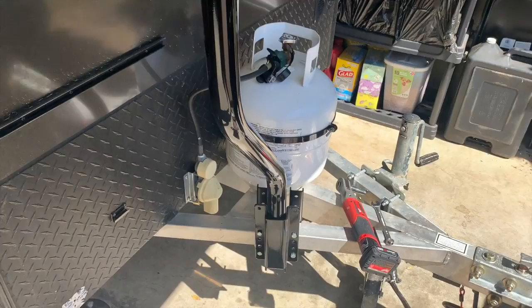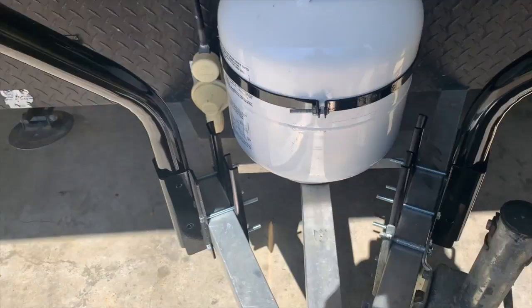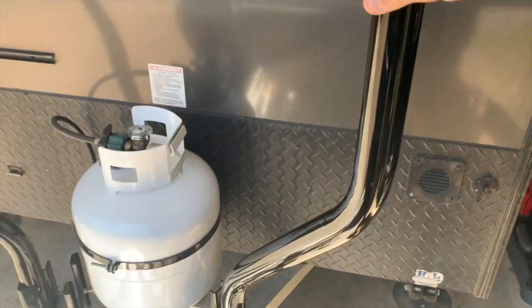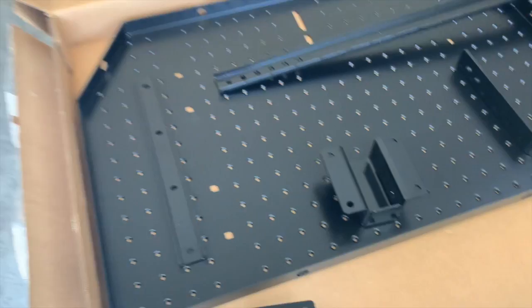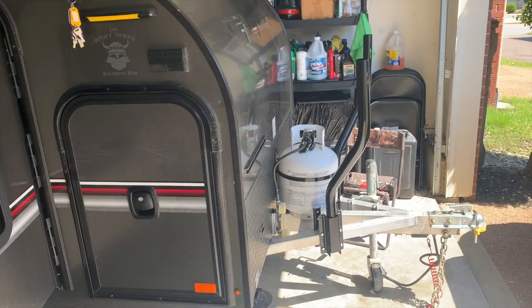Sorry for the shadows — it's just where the sun is right now. I've got both of the lower brackets assembled on the A-frame of the tongue, and I have both of the poles in place, which at this point move freely. They'll obviously line up with the top hats that will go on the side of the tray. The next step is to mock up the tray to see exactly where it's going to fit.